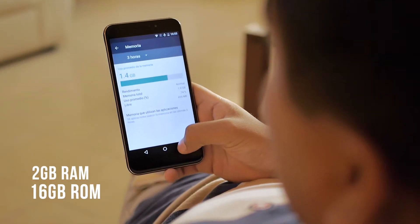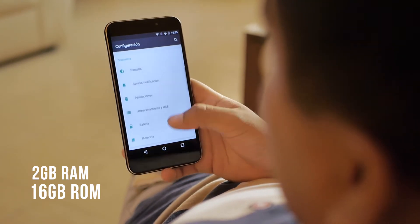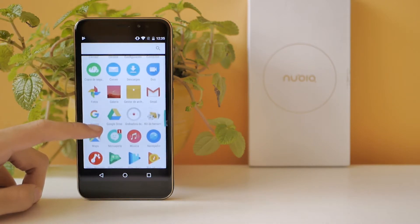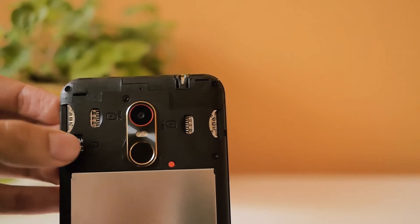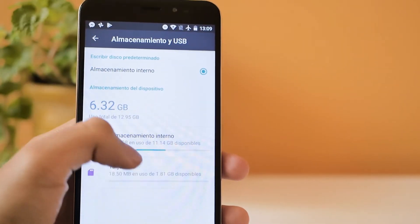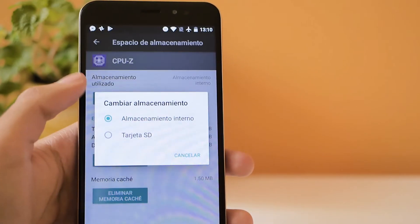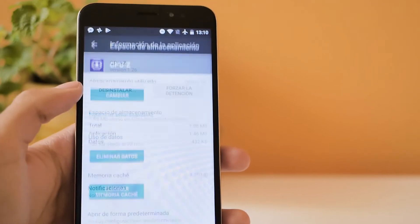This device only comes in a 2 GB RAM and 16 GB internal storage version, and since it runs Android Stock 6.0 it is quite generous with the usable space — around 11 GB, from which we should subtract about 500 to 600 MB occupied by pre-installed apps and their stored data. All pre-installed apps are Google apps with nothing extra from the factory. We can also expand storage up to 32 GB via microSD according to the manufacturer, but technically there is no reason it shouldn't support up to 128 GB. Thanks to Android Stock, we can move apps to the microSD, unlike other manufacturers whose firmware doesn't offer that option. The most advisable would be to use very fast cards, Class 10 UHS-1 or UHS-3, with write speeds around 80 MB/s so as not to negatively impact performance.